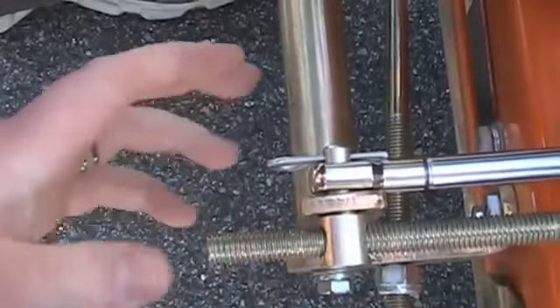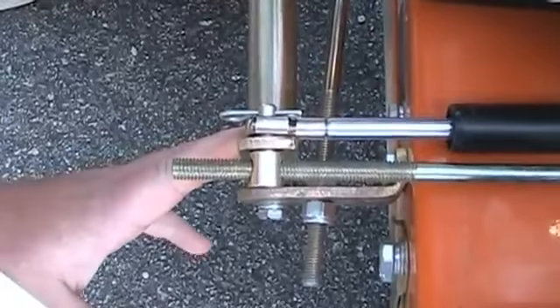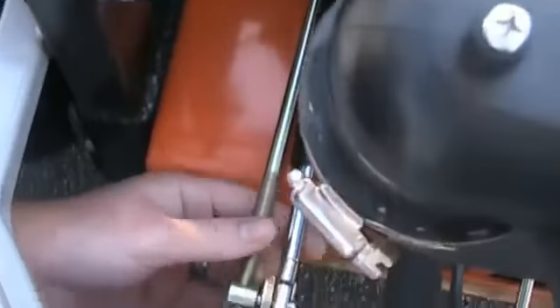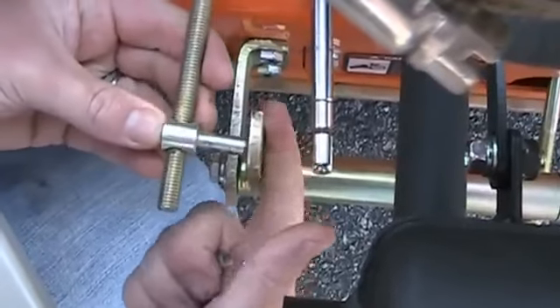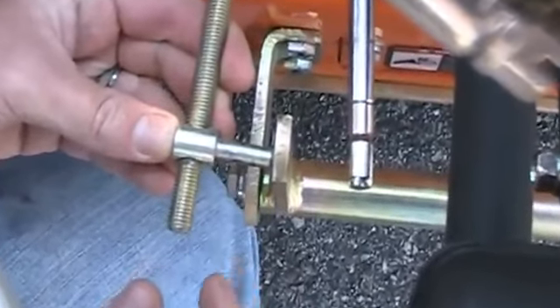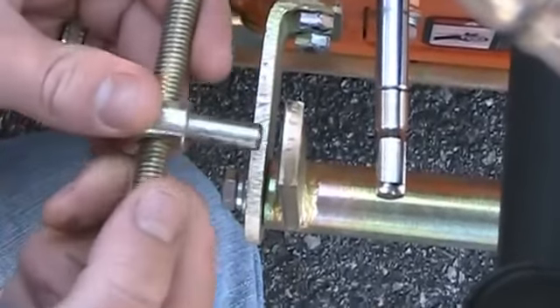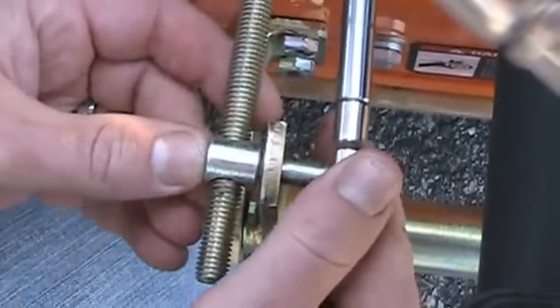This is going to put your mower at max speed on the right hand side. Lock your handle back into neutral position. Come to the left hand side with the left hand handle locked into the neutral position. Uninstall your gas shock and your linkage and check to see if this linkage lines up. If this linkage does not line up in the neutral position with the handle in the neutral position, adjust this linkage until it lines up perfectly with the hole. Reinstall.